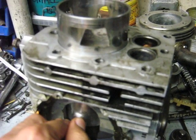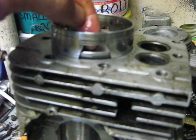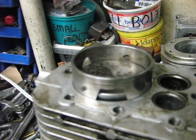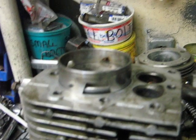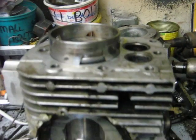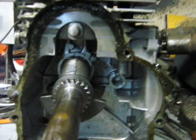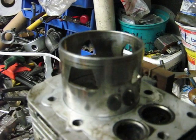You might have just noticed that the piston sticks up past the top of the block. The way I accomplished that was by putting in a four-horse connecting rod out of a model 110 — an 11 cubic inch engine. The rod is about 0.2 inches longer, which allowed me to increase the compression ratio by remachining the head. We went through a lot of different stages in the development of this engine at university, running it on the dyno.